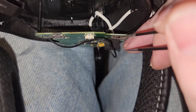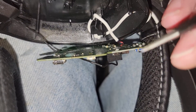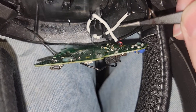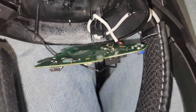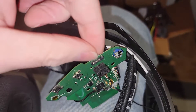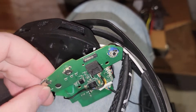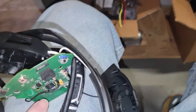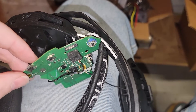I'm going to try to stretch the coils out and work it a bit more, then get this back together and see how it works. I'll stretch it using small needle-nose pliers in between the grooves to pry them apart. That didn't really work in place, so I actually had to take the board out — not incredibly hard. You remove one thumbwheel screw and one small silver screw going into the board, remove the little turning wheels, and it slides right out.